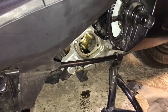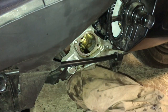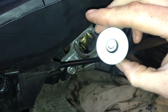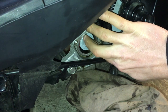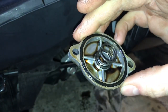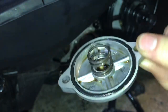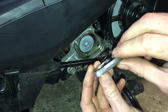We've got some light — we can see what we're doing! We've cleaned out the oil filter housing of the old oil as best we can, and we have the new oil filter — the High Flow Filter OHF-973 — which looks just like the old one. There's an open end where you can see inside and a closed end which needs to be nearest to us. So we're popping that in there — the reversal of our fishing earlier on — and then we need to put the cap back on. There's the cap all cleaned up, with the sealing ring and the spring in there — important to remember that.